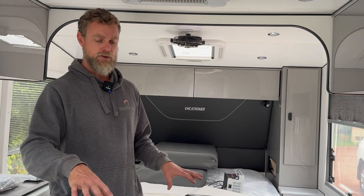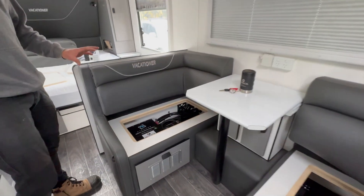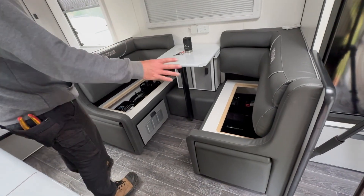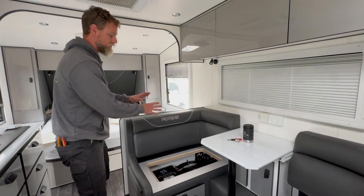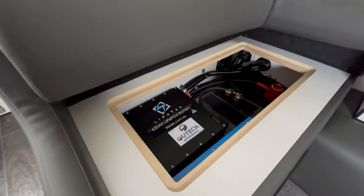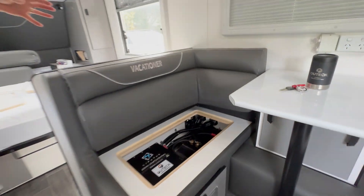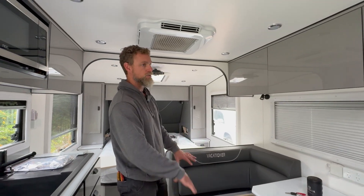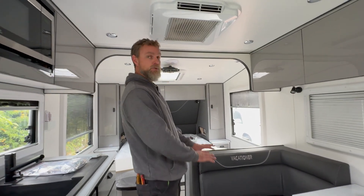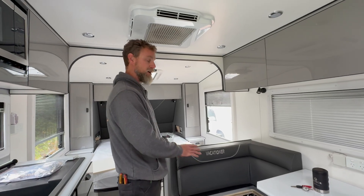We'll just quickly have a look at the layout. This van has a café lounge setup with two individual seats — both seats had drawers in them, so we've made the drawers redundant. On the front side seat box we've got the 620 battery isolation and battery monitoring, plus we've actually installed the inverter charger in that side as well. This keeps the inverter charger separate from the other chargers, allowing us to cool the system down through ventilation fans more easily, and it also keeps the cabling short — a very short run between the battery and the inverter, which is super important for minimizing volt drop.